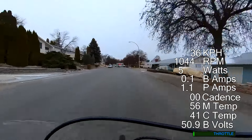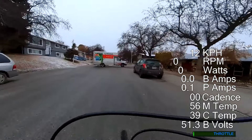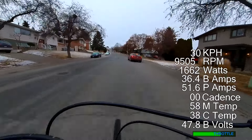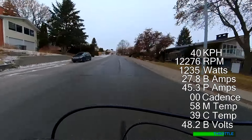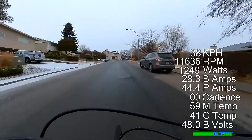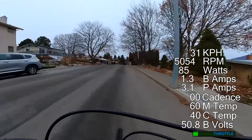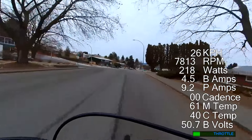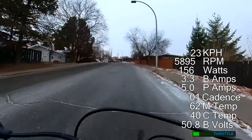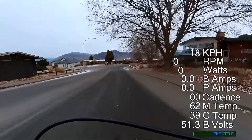We're reaching 55 degrees now and I don't think I'd do much more on this. I'm going to be cutting it short fairly soon, mainly because I don't want to destroy the motor. I could keep pushing it and keep pushing it. We do have rollback on there, so I want to play about with that as well and see — does it hold at a stable temperature at any point? Does it get to 65 and then kind of stay there? Is there enough mass to let it cool sufficiently and still take this kind of power? We're above 60 degrees C, so I'm calling it a day at that point.